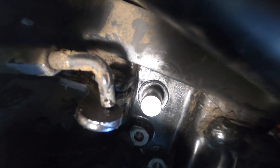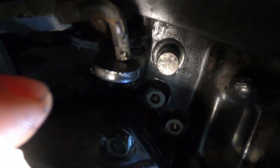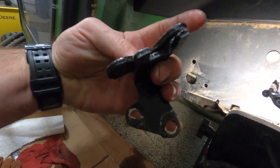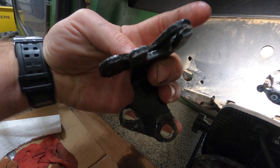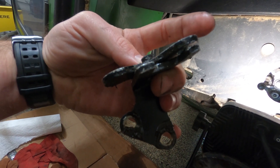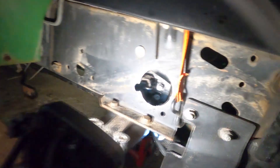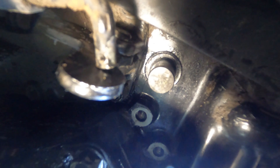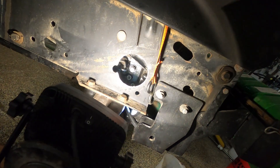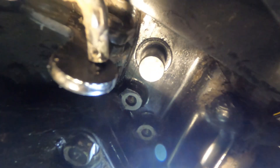I got it back in. You can see there, the new seal's in. Here's what I had to do — these two bolts down here, screw this into place. This is part of the differential lock. I tried to do it without this and I just could not get the right angle to get the new seal on. So I took this off and it was really easy to slip that seal right on. Drilled a three and a half inch hole right there, took a few things apart, got this slid right on.